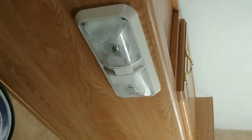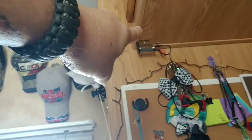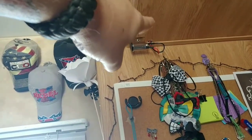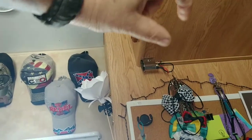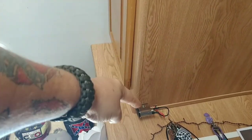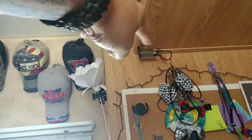I did the wiring on my thing that's underneath my nightstand. I did 12-volt — I took the light out and ran wires. You can see she has a 12-volt now. What I did was I took a piece of baling wire — Rednecks, we have duct tape and baling wire, and if we don't have either one we're screwed. I ran it over here to the opening and fed the line through there so now she has a 12-volt outlet on her side of the bed, which is where she wanted it. There's a little gap on the shelf on the inside — I ran the wiring through there so she could have a 12-volt outlet on her side and I could have one on my side.